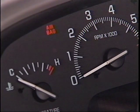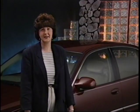The airbag telltale is controlled by the SDM over Class 2 communication to the IPC. If the IPC is not connected, the SDM will send a fault code related to the warning lamp. The IP cluster diagnoses the telltale and tells the SDM if the telltale is bad. The SDM will then log a fault code 61.